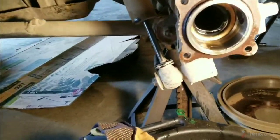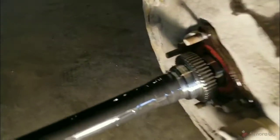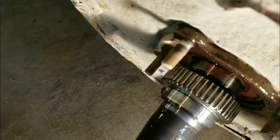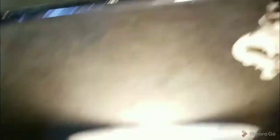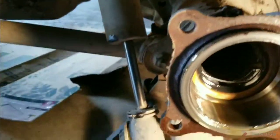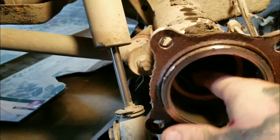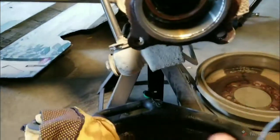With this side apart, you can tell all that grease down in there is not supposed to be there, and all the grease on that tone ring is not supposed to be on that tone ring — that tells you the seals are leaking. I imagine pressurizing the differential had some help in that. You can even see in this one that spring coming out of the seal — that spring was just laying in there. That's bad, because that's part of the seal. So new seals are going in here.